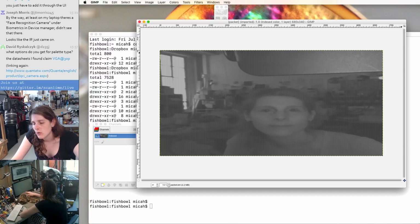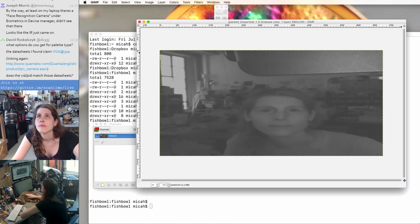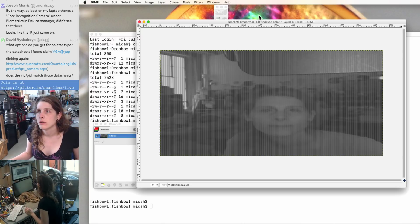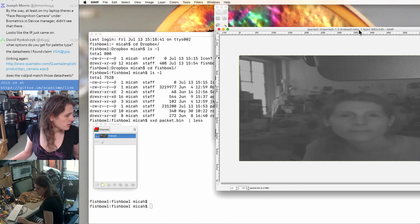It might be interesting to know how Windows Hello chooses the device. Like, what would it take to just have an arbitrary UVC device identified as an IR webcam by Windows Hello? Yeah, we could see if the VID PID match, sure. What was the VID PID?